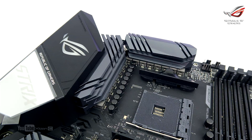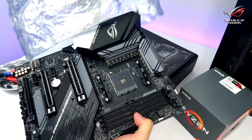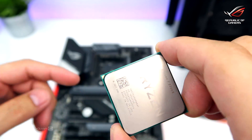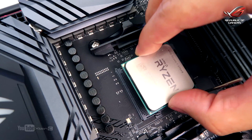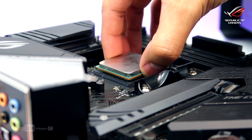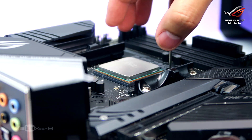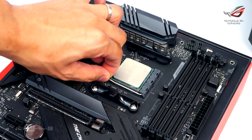The VRM are equipped with a large heatsink that has an 8mm copper heat pipe for better thermal headroom. Before installing the CPU, take the motherboard out of the anti-static bag first, then place it on top of its box. To install the processor, hold it up and look for the corner with a gold triangle. Don't touch the golden side of the processor. Lift up the retention arm, carefully align the corner with the triangle in the motherboard socket, and drop the processor into the socket without using any force. Slightly wiggle it to make sure it's properly seated — it should just snugly fit in. Then bring down the retention arm to lock it in place.